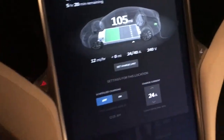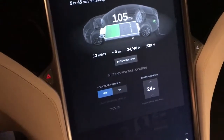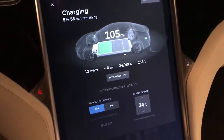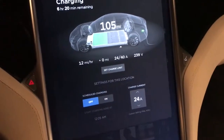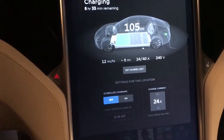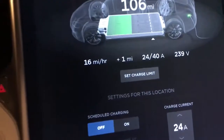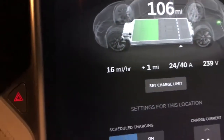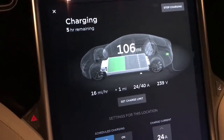When you're charging, you need to dial down the amperage. Even though you're plugged into a 14-50, the mobile connector thinks it's a 14-50, but you're technically plugged into a 10-30. So you have to dial down the amperage to 24 amps or lower. The magic number is to be under 80% of what it's rated at — it's rated at 30 amps, so I dialed down to 24. I've been getting about 16 miles per hour of charge.